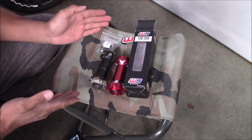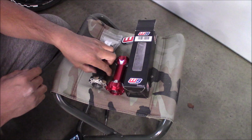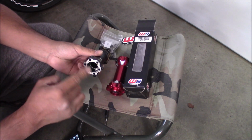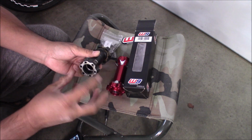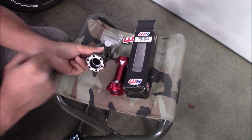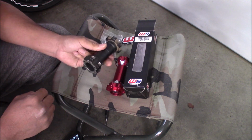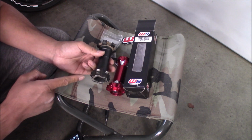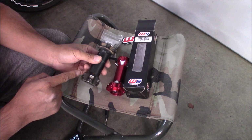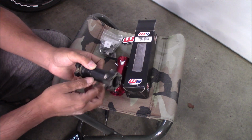I have never destroyed a jackshaft, right? I mean, what's wrong with this one is I think the bearings spun in there, and then the bore is off now, so the bearings spin in the bore. Remember, you need to be able to press these bearings in there, okay, guys? That's the way the bearings are press fit. So that's how this one met its end. As you can see, the chain came off and it chewed it up quite a bit. Sur Rons like to do that, let's say.